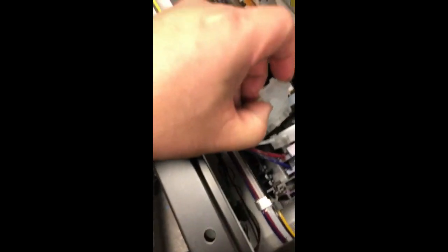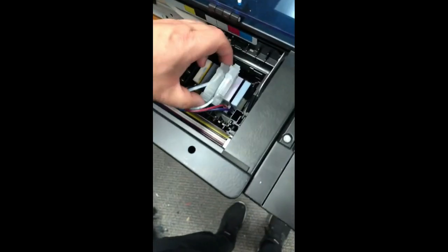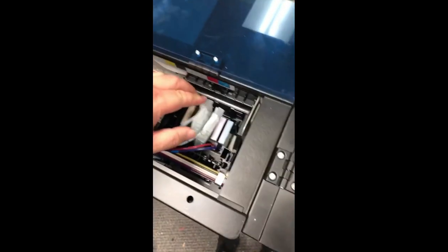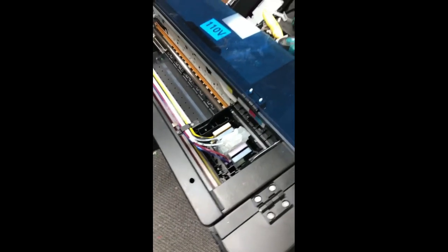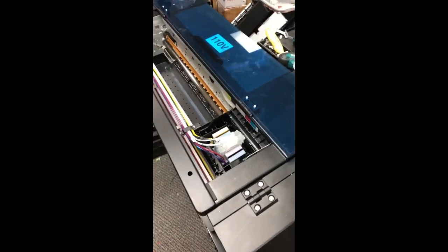I don't know how to fix this — I have to ask the customer. The only way to fix it is to install a real white ink circulation system, otherwise you're going to have this problem again. I don't know how feasible or affordable it is, because the customer bought a $1,300 printer, but I'm suggesting putting about $150 — roughly 10% of the printer cost — into a proper damper system.